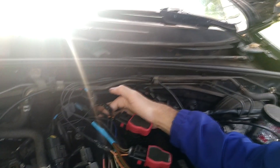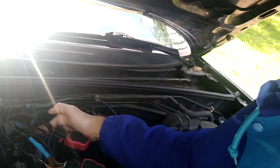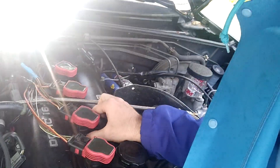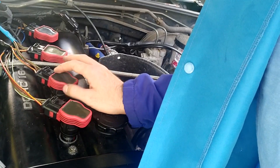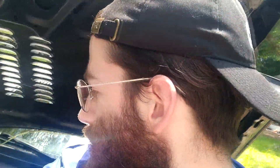You get all this extra room at the back of the head - good if you want to do a coolant reroute, and it just looks better too. You'll still need to find a way to mount them with a plate since they don't have mounting holes like the Toyota ones. There's an Australian company on YouTube that tests coil packs on 2JZ setups and these ranked seventh out of sixteen, with Nissan stuff and AEM above them. They're really cheap and popular on SR engines.